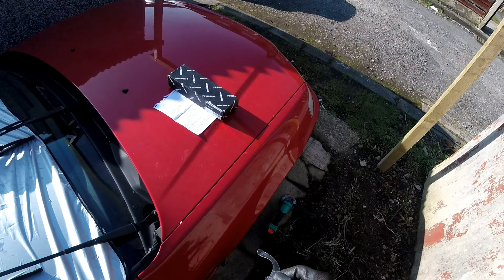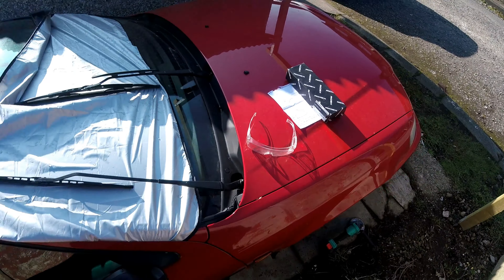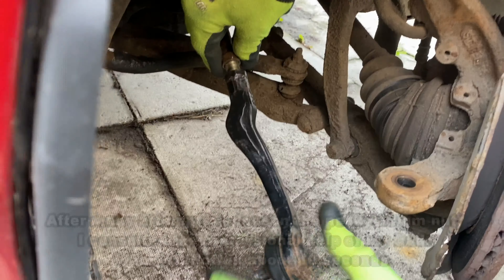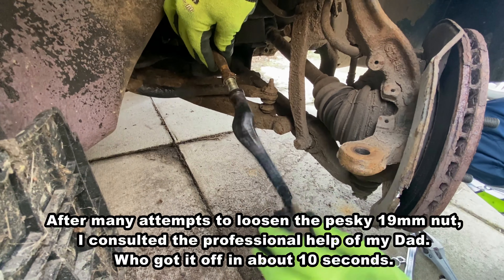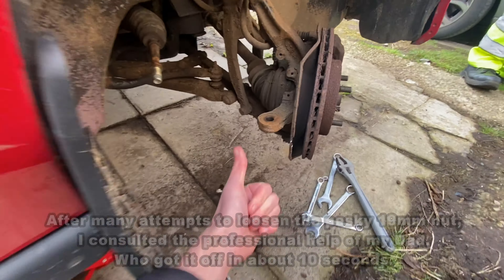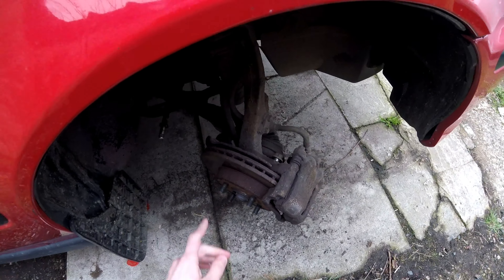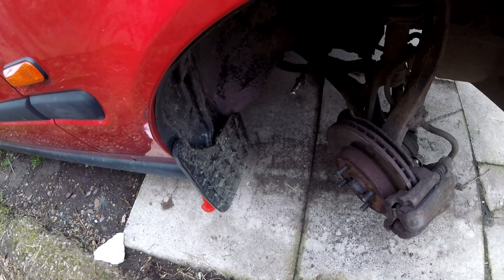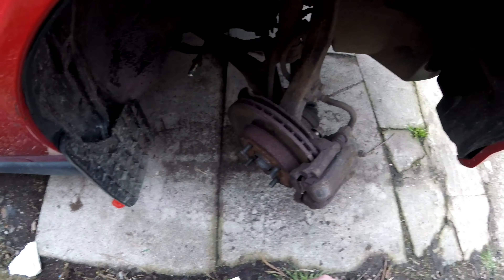Let's move on to the next bit. Remember, always wear safety glasses, because bits of metal do go flying everywhere, so safety is always very important when you're doing jobs like this. You don't need the ball joint splitter because we've ground it away. So what we need is this 19mm spanner — I'll show you where you need to put this one. The last time you saw me here I was with my dad, because I needed some professional assistance to try and get this track rod off. It's completely off, and today we're going to be putting the new one back on. It's been a couple of days since then, so let's just crack on with it.